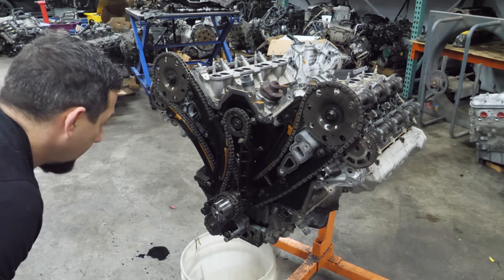We're going to need a lot of penetrant. The rust is very thick, and when you get to this cylinder here, that piston has a few marks on it — like maybe it swallowed some debris. The interesting one is this one: it's got an outline of valves on the top of the piston, and if you look at the height of the piston, it's actually sticking out of the bore, beyond the deck height. That can only happen from one thing. It rocks on the wrist pin. Maybe the head gaskets are so thick that's just how it is — but it still came up and hit the cylinder head.